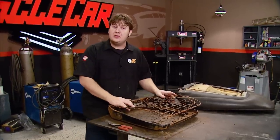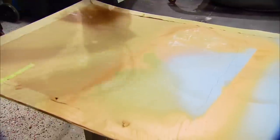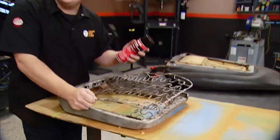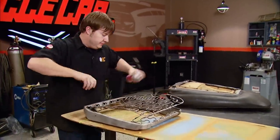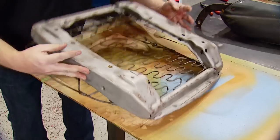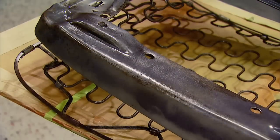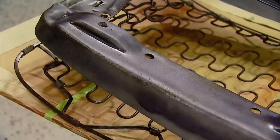We're going to speed it all up by taking a trip over to the Blast-It-All cabinet. Another advantage to bead blasting besides speed is that you can really power through the gnarly stuff and get down to bare metal. With our piece all prepped, we're going to hit it with a coat of Loctite Xtend rust treatment. What this stuff does is destroy rust, then seals and protects the metal. Anywhere it reacts with rust it will turn purple, and then once it dries it forms a primer coating. If you're working with body panels, it also jives with plastic filler and fiberglass.